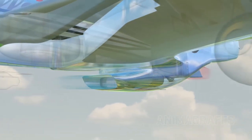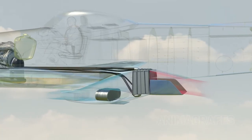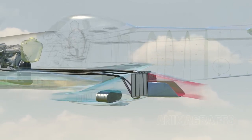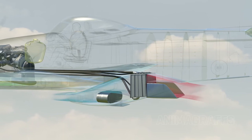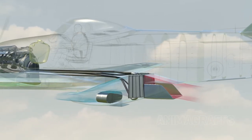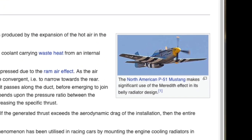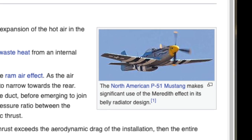Designers were deliberate in the design of that cooling system to not only achieve high efficiency of cooling, but also limit or even eliminate the drag caused by the air passing through the core. It's actually recorded that the system alone is responsible for an additional 15 to 20 miles per hour at the same engine power settings. The Mustang has its iconic belly scoop down below for the intake for the cooler. It's ducted through a diverging duct to the radiator, and following that, ducted out the rear through a converging duct. They call it the Meredith Effect.